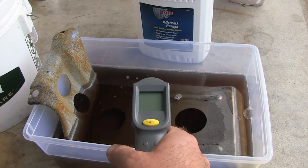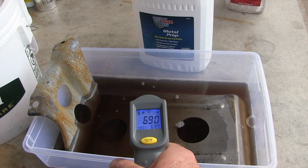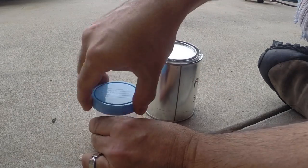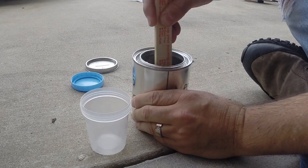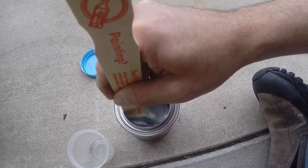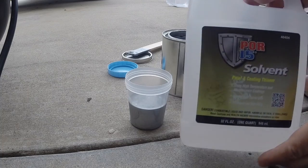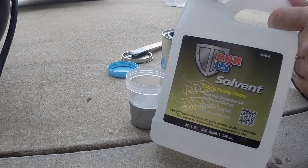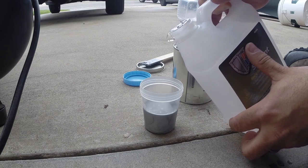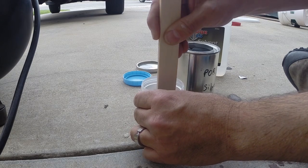Tending to the new battery tray now — doing the metal prep. Metal prep should be done between 65 and 90 degrees, and we're looking at about 69, so we're okay. It's almost two o'clock and the wind is kicking up — I've got to get this going before it gets too windy. POR-15 should be stirred, never shaken — there's sediment at the bottom and particles that need to be mixed in. POR-15 is pretty thick stuff and needs to be thinned using only POR-15 solvent. I looked for thinning directions on their website and it said to thin to desired consistency.